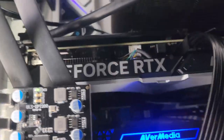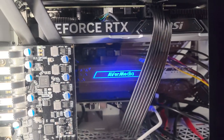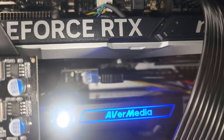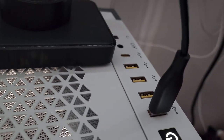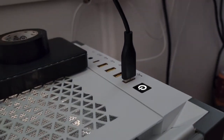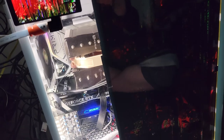There is one more card in there just underneath the graphics card, between the GPU and the capture card. The reason for that is because this case comes with four USB 3.0 ports on top and a USB-C. The motherboard, however — and this is where I learned a lot while building — only has one USB 3.0 header, and there are two cords. Because these first two and the second two are each their own cords, only one could be plugged into the motherboard, leaving two USB ports completely useless.